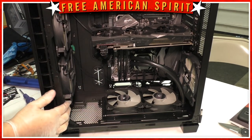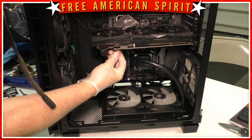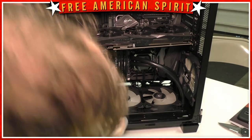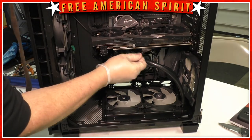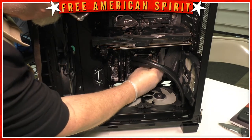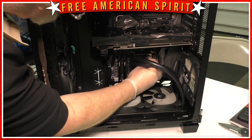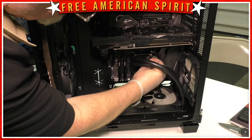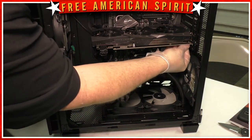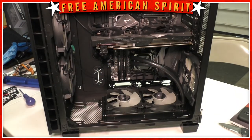The card is installed and the connections checked. I tucked the power cables into the back to keep things tidy — I'll do more wire management later. One last thing I almost forgot: peel off all the protective film. There's film on the graphics card here, film over there, and there's some film on the water cooler I hadn't peeled off yet. Make sure you remove all of it before powering on.